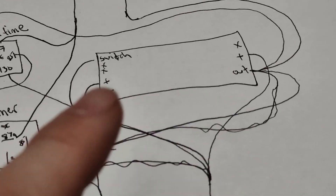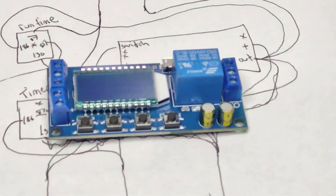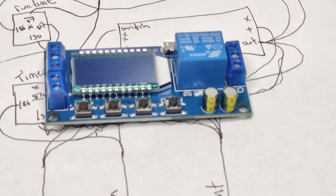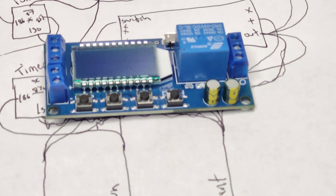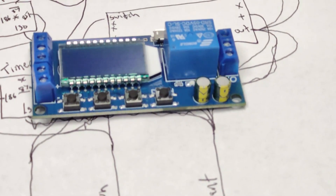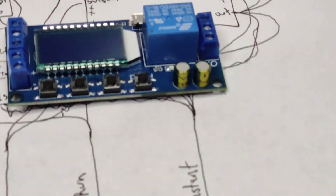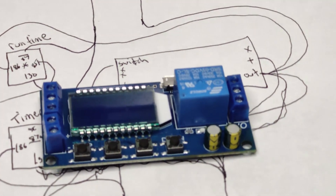I'm starting the timer at 130 seconds — I don't know why I picked that number but it seems long, so we'll see. The other thing I did was read the user's manual for this little device. It actually has a low-power state where it doesn't light up the backlight at all, and it takes so little current I can't measure it — 0.00 amps. It'll be a very, very small draw, which is phenomenal. Now I just have to hook all this stuff up and see if it actually replaces all the functionality of my cluster.